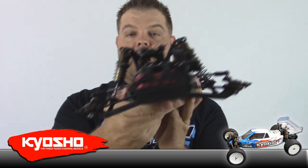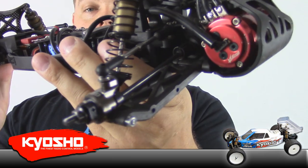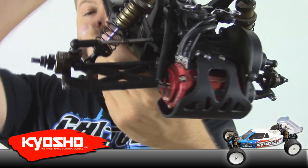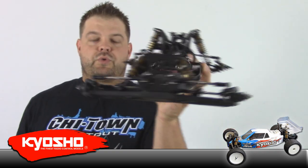I'm running pink springs in the front and red springs in the rear. I'm running the gull-wing rear arms and a really long rear link. I'm also running the version 2 aluminum hubs from Kyosho. This car is really interesting — I actually like it better in rear motor than mid-motor. Because it has so little droop it tends to run like a touring car. Indoors, this rear motor car has as much steering and feels similar to a mid-motor car, just with more rear bite.